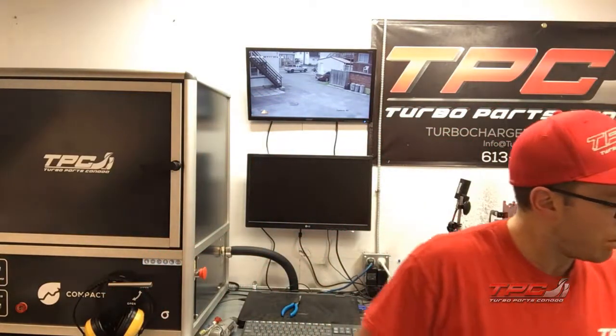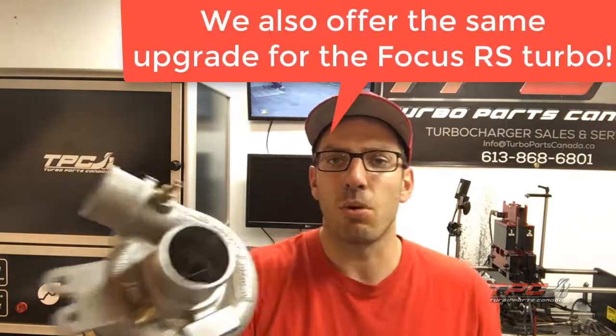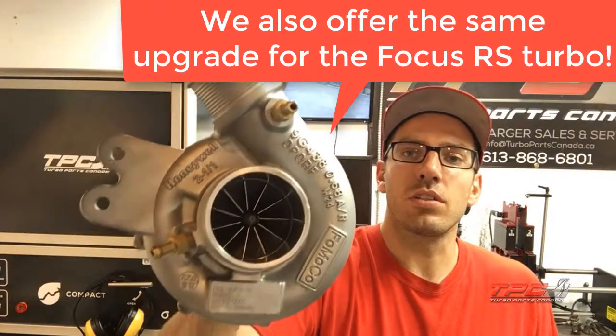That's only if you're up to the task. If you're kind of rough with things, just take it out whole — we're going to reuse that turbine wheel so you can't have it damaged, or else we're going to charge you to replace it. We have the CNC programs all in-house for high-speed balance — low speed first, then high speed. Everything's all CNC. I'll probably post pictures with the cover off so you can see inside how it's all polished.